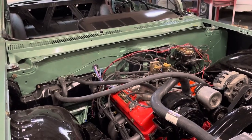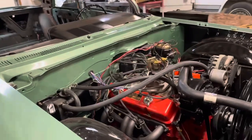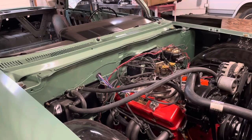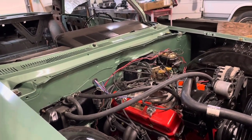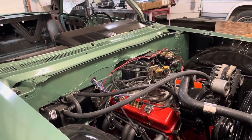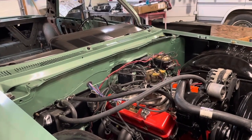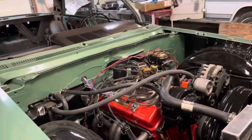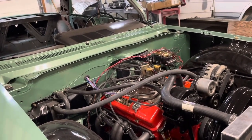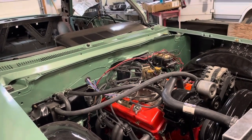So to go back where we left off, this thing would start. When you were revving it, it would back pop through the throttle body a little. Not continuous, like I would think from a valve, which it could be, but I don't think that's it. I've done some troubleshooting reading, and it's pointing to an ignition problem, possibly a vacuum leak, or timing problems.